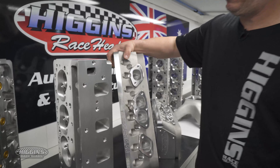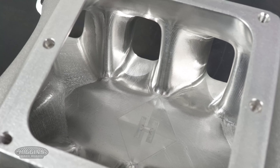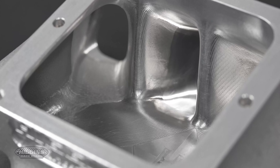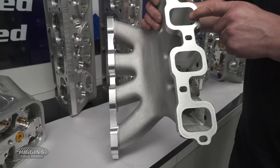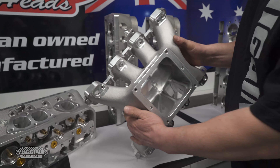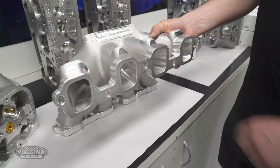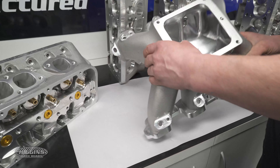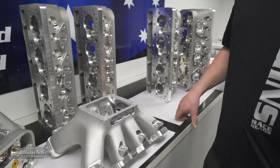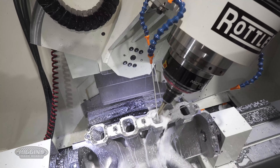Everything's done for you — pushrods done, drain backs done, water done. That will have a different exhaust port in it. We're going to have several different port configurations. This is the manifold we do — when you buy this combo with our head and manifold combos, it comes fully CNC ported. This is the Chevy one, so it comes fully CNC ported and match ported to the cylinder head. You'll have different deck options — your nine-inch tall deck ones. This one's an injected one, so it comes injected or non-injected, and all the flanges get detailed. This is what you're paying for — you do not have to send this out. To do something like this could cost you twelve to fifteen hundred dollars extra, but it's already done for you.